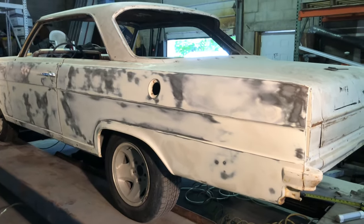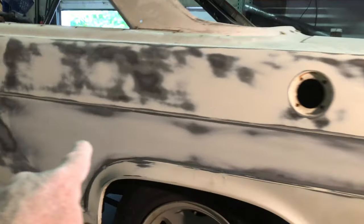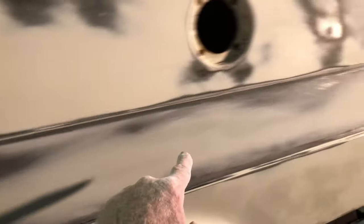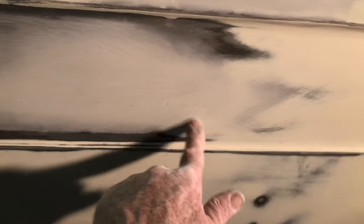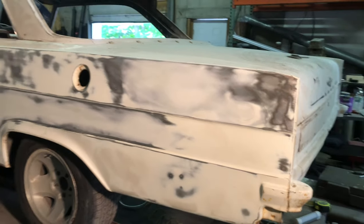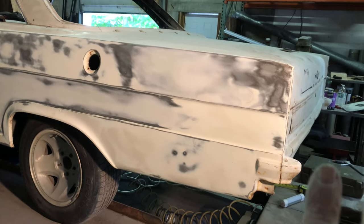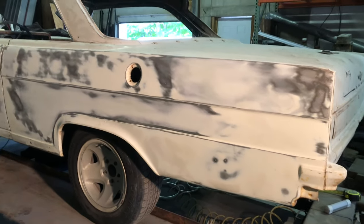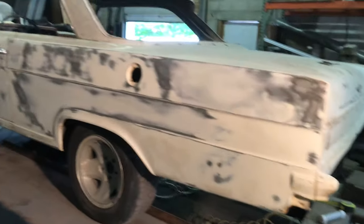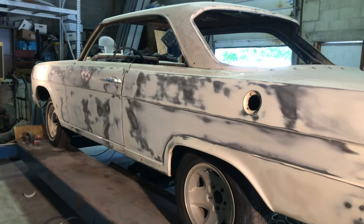This is the first side — that big crease down the side is all gone. Probably started here and went all the way up. I've got to get rid of a few pinholes and stuff, but that's the major work done. Tomorrow I'll go over the whole lot with 120, and then I'm going to use U-Pol Reface, a polyester spray putty. I'll do all the flat panels all the way across, then block sand that down with 180.